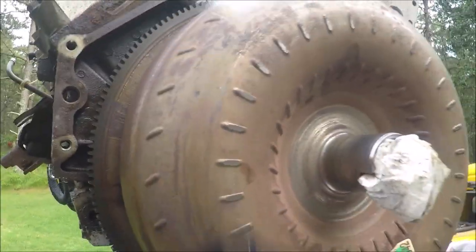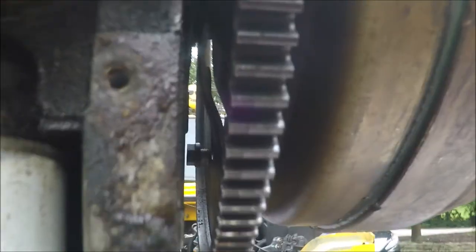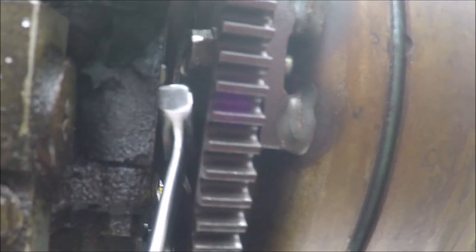Alright, so a sleigh problem. Motor's locked up. We can't spin it. On the back side, we have three 15 millimeter bolts that we have to break free. Two are broke free. This one's starting to strip. So we can almost get a wrench in here. So basically, we're just going to shave maybe a 16th of an inch off the wrench so we can get it on there, use the box end, and break it free. I mean, we're really close, but not quite.